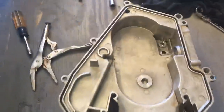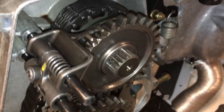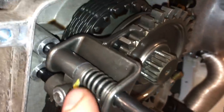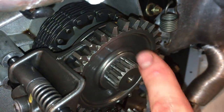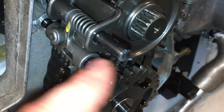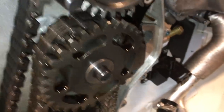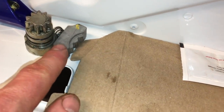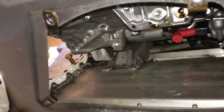Here's the correct orientation of your chain case gears and actuator for reverse: make sure the short side of this is facing in, your gear is in with the flat side out, and your spring, your collar — make sure this magnet's cleaned up, your two posts all the way in. If you lose this washer when you take it apart, that's where it goes. Note that before taking the chain case cover off, you should have taken out the reverse actuator shaft and the little notch piece, but I'll show you how it all goes back together.